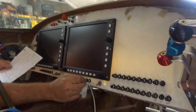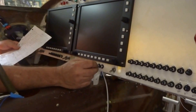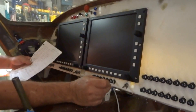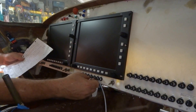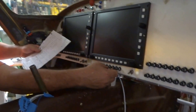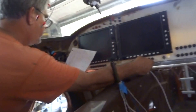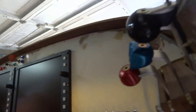That should be a 3-amper. COM 3, 3 amps. Transponder and aileron trim — transponder, we don't want this on, I'll leave this off. EIS display, 8 amps. GPS — 5, 3, 2. Off on GPS, there isn't any. Transponder off, aileron trim off. Alright, next bus, number three.